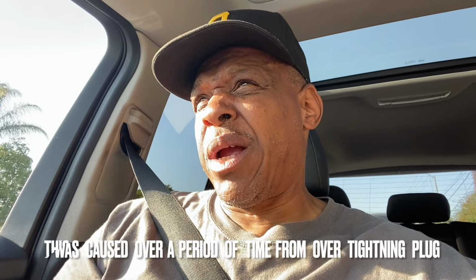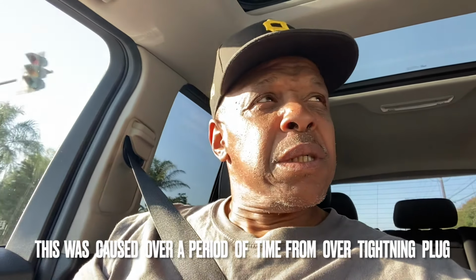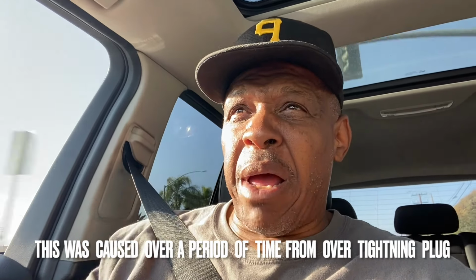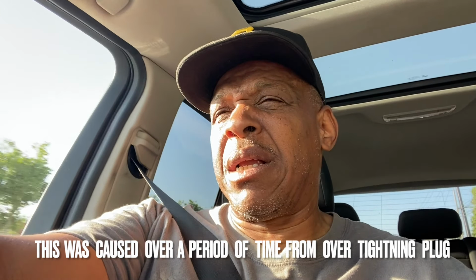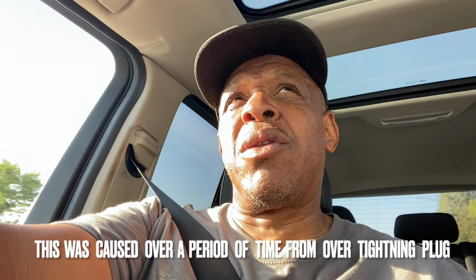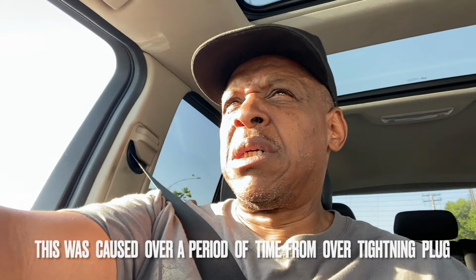My bike is actually behind me. One of the club brothers got it on the trailer. Evidently, when I put my primary plug back in the bottom, I had to have been putting it too tight. So what happened when I went to change my primary fluid a couple of hours ago? The threads came out with the bolt. So yeah, the threads are ruined in that casing, in the inner primary.